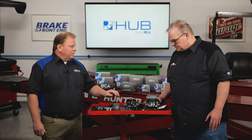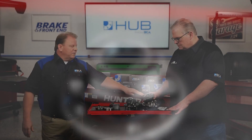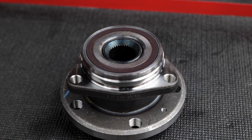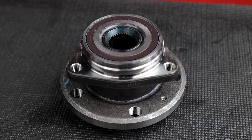The only thing to really worry about is corrosion in the bore of the knuckle, which is common on some older Teslas since they've been out for almost more than a decade. It's a common problem having dissimilar metals in contact with each other. You'll get a steel-housed bearing assembly, and we apply a dichromate or rust-preventative coating to minimize that. I also like to put a little dielectric grease to keep conductivity down between the two dissimilar metals.